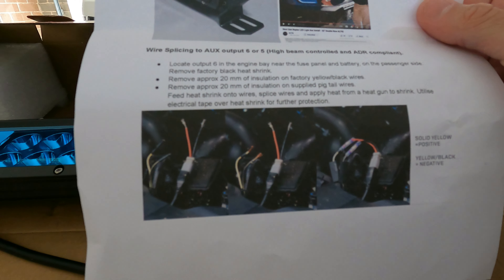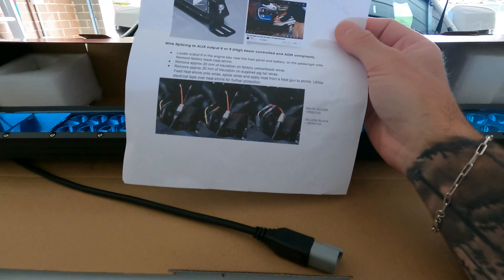It's a little bit fiddly but nothing too hard. The best thing about the Raptor is the roof switches. As I've since learnt since my last install, that's actually its own circuit — so you don't need relays, nothing like that. It's literally just positive to positive and negative to negative. This install just couldn't be simpler.